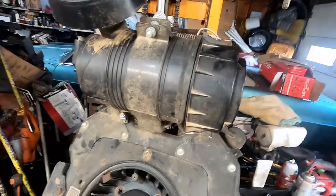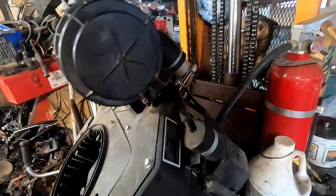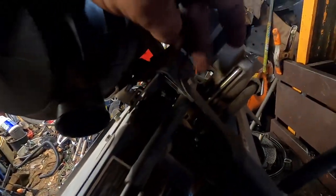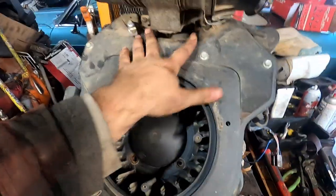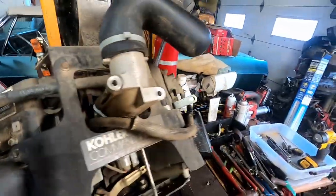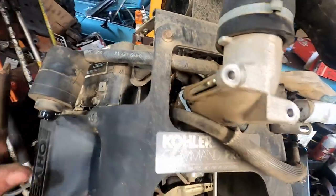We're going to go ahead and get this air cleaner, air filter assembly off of here. So it's a 1/2 inch nut and bolt there. And then under that, you're going to have 2 5/16ths, one here and one on the other side, 2 10s, so we can just pull this whole thing right off. And then there's going to be 2 Phillips screws right there once you get this off. So instead of taking these 2 5/16ths bolts out, I actually just took the 4 5/16ths bolts out that hold this plate on and valve cover here.